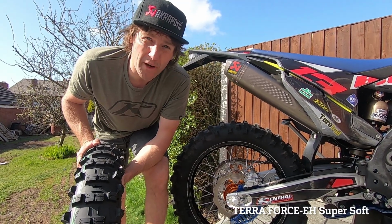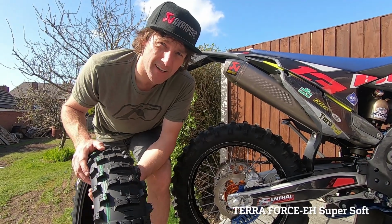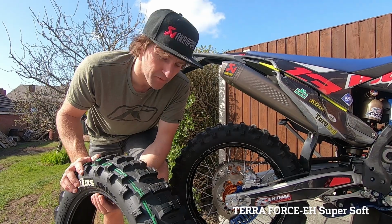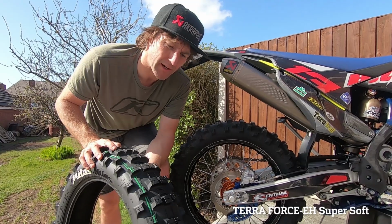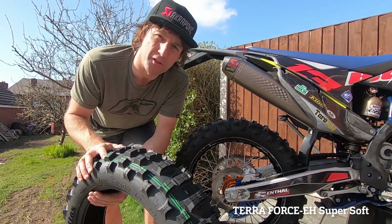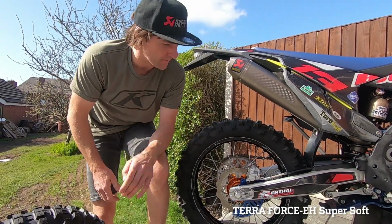But it always pops on the rim. The most amazing thing about Mitas tyres is no matter what size mousse you've got in, it always goes onto the rim, which a lot of other tyres don't sit on the rim very well. So you might see some of the factory boys with 3 rim locks in, and that's just to keep them tyres on the rim and to be a bit extra security.